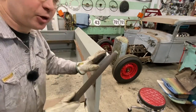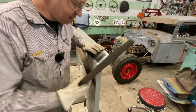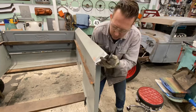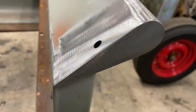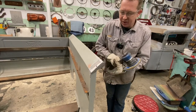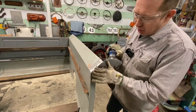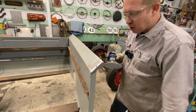I'm going to use this file to put a little bit of radius on this edge here. Right now it comes to a very crisp point, and that's not what we want. Then we're going to take our sander again with a fresh piece of 80-grit and give it a final dressing — try to get some of the grinding marks out, turn them into DA marks, and blend this radius in to make it all nice, uniform, and factory looking.